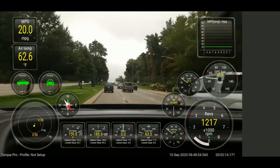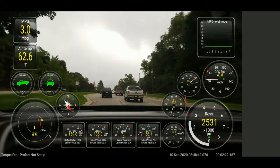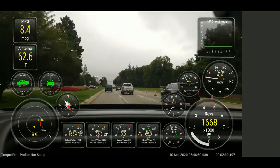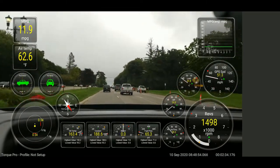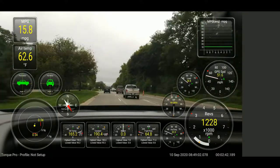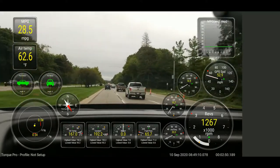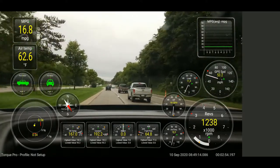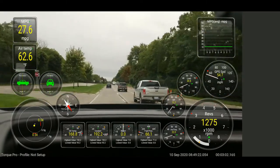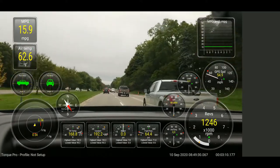I will say to anybody interested: be cautious with the Torque Pro app because it does not function on the current version of Android. Android 9 is the last version where this app actually works. I had to grab an old phone with an old version of Android to make the app work. So heads up — if you've got a new phone running Android 10 or 11, this won't work. Also, the developer doesn't seem to be correcting that. The version you need is a $4.95 purchase, and I don't think they're supporting it for Android anymore — just FYI.